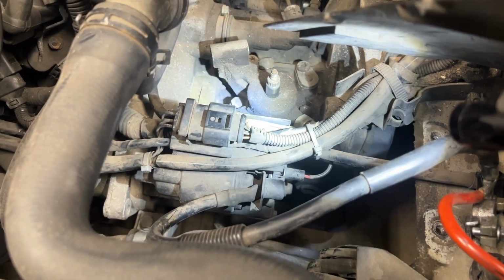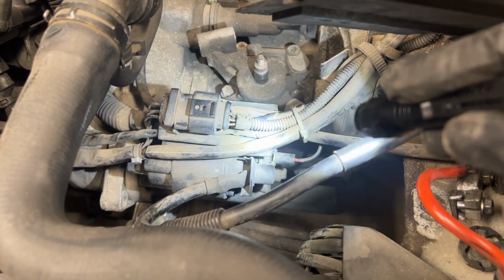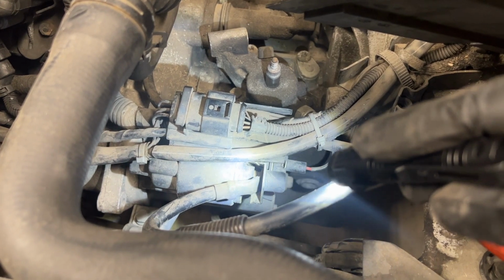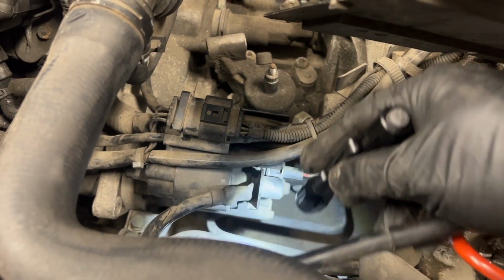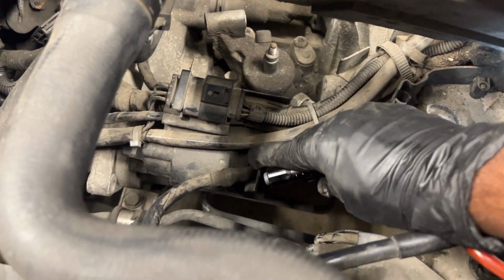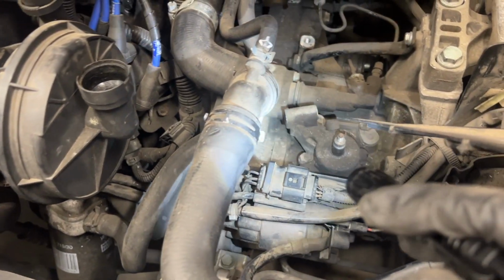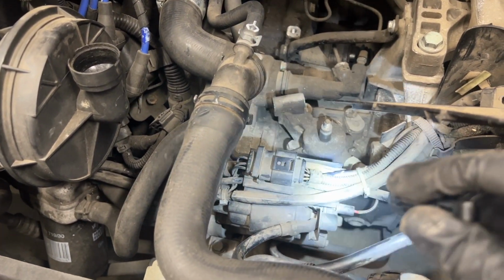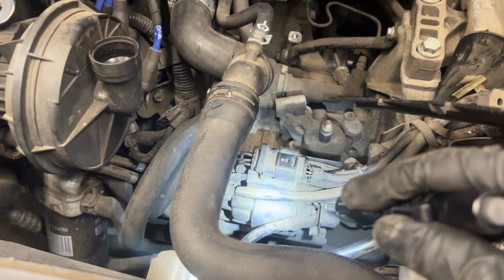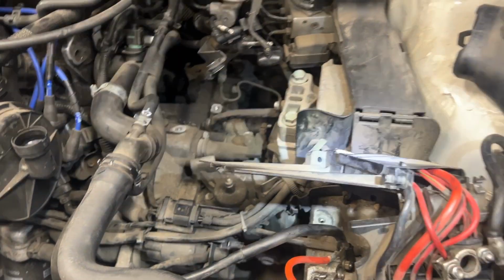Now, time to remove the signal wire. That's the black or the red wire going into that connector. It's a squeeze connector. Push it down, top and bottom, and then pull it out. And then there's this weather seal protector for the positive connection going to the starter. You just pull it out. And then there's one bolt on the top, and looks like there is one on the bottom. So taking the top one off, and then we're pretty much done here, top of the engine bay.